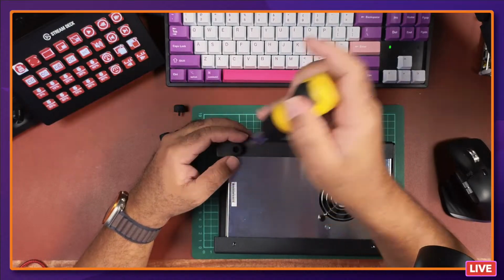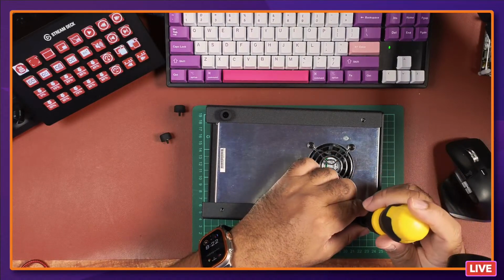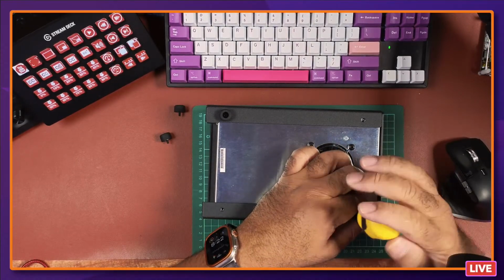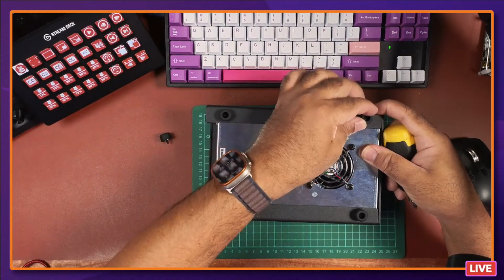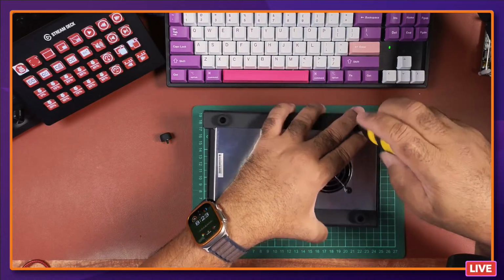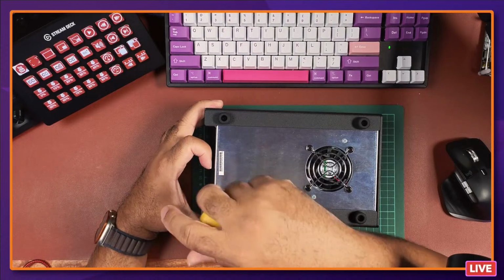Okay, also, another old tech trick: when I screw these things in, I do not screw them in completely tight until I get all four screws started and inserted. Sometimes you have to give these things a little massage in order to get the alignment straight, and that just has to do with weird manufacturing. Normally not a problem on Apple hardware, but this ain't Apple hardware. And I can already see that foot doesn't really align, so I have to give it a small squeeze when I drop this one in. Then I go back and tighten them all at the end once I get them all in place. That would save you the frustration as you're trying to put it back and you feel like it's not going back in.